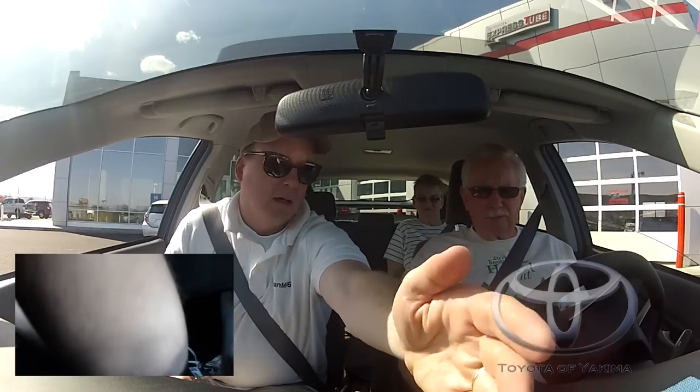But while we're talking... You don't put it in neutral? No, leave it in drive, because that way it's charging the battery. Now, from the halfway bar to the left is all your EV, okay? From the right, that's your power. And on your power area, you only want to go from about halfway to about 3/4. Okay, from the half bar to 3/4. That's the efficient range of acceleration and how to use the engine.